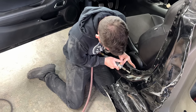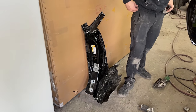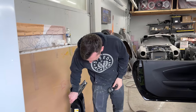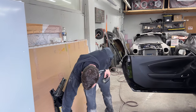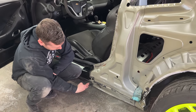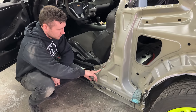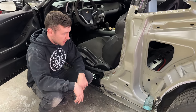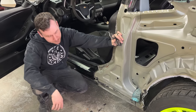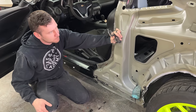There she is. Alright, find another VIN sticker — I was literally just thinking that. That's the only thing that is a little inconvenient about where this thing is damaged: the VIN sticker is going to be on that panel, so I'll have to hang on to that just for originality purposes. Look at that though — cool. I cut it through this circle right here, so there's a nice locator. On the new panel I can find this exact cutout and then cut straight through it. We have these two holes for the lower door catch to line up, same with the ones for the actual latch.